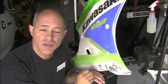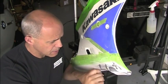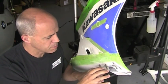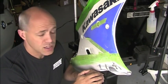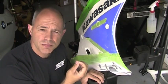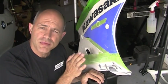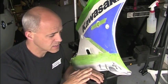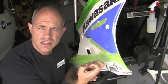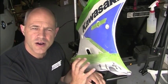Using a block or wrapping sandpaper around a block drastically reduces ripples along the length, though you still have to roll the block with the body with every stroke. Generally speaking, you don't get ripples along the length, which are very noticeable when the surface becomes glossy — even on the underside of the bike. I started with an 80 grit to take off that initial sticky layer on the outside of the cured putty, followed by 100 grit to smooth out the lumpy parts, then 320, 400, 600, and finished with 800 grit wet-dry sandpaper dry. What I have now is a finish that has tooth — something for the paint to grab onto — but at the same time it's very smooth.